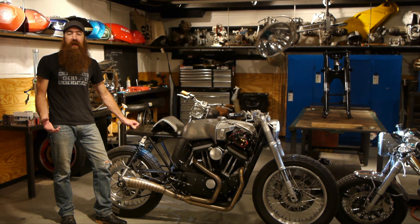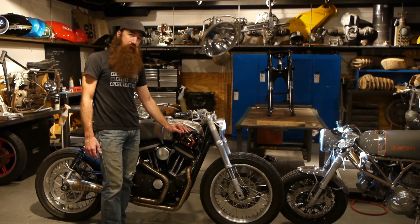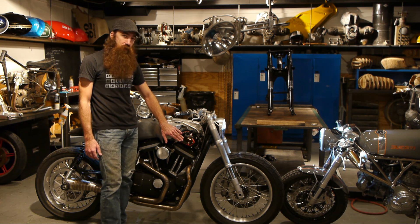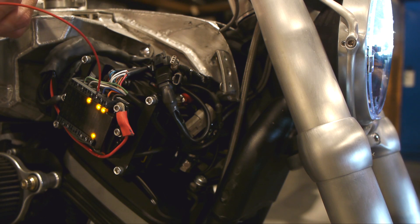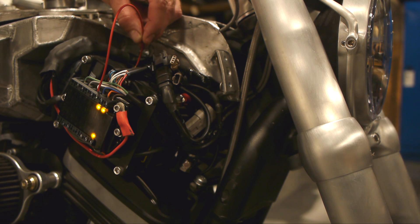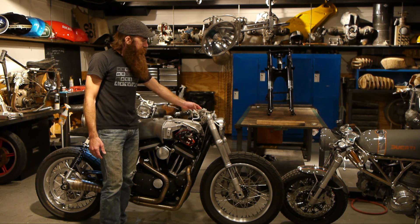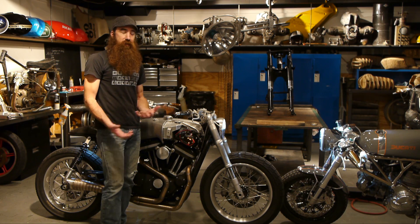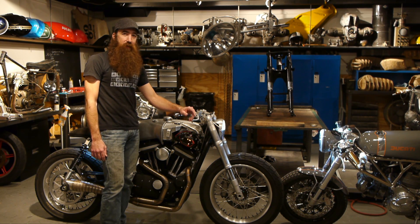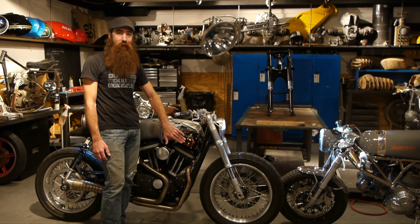One of the other really neat features of the M-Unit is that it's a fuse block replacement. What I've done is add a wire here that I'll use in a moment to short out the system. Notice that all of the LEDs are lit showing which inputs and outputs are active, and you can see the headlight is on. Now I'm going to give this a direct short to ground — a few sparks — notice this output has now started to flash, the others remain in normal function, the headlight's gone out. And now to reset that fault, just correct the short, turn the light back on, and you don't have to replace a fuse or have your bike die on the side of the road — you can just keep going as though nothing actually happened. Best if you can get your wires to not have shorts, but if you have a dodgy harness this can save you a lot of headache and stress.